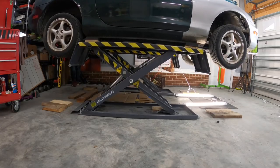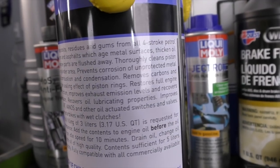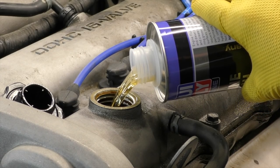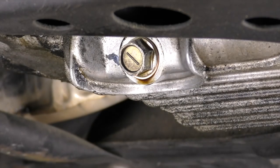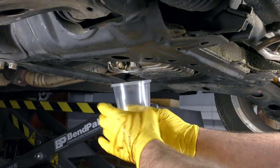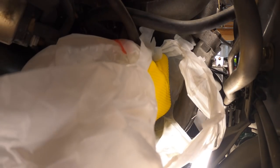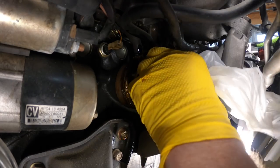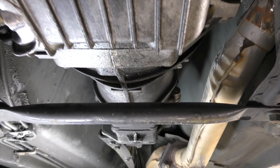Let's start with our oil change. This is a pretty straightforward oil change, but we're also going to do an engine oil flush — we'll add the flush treatment to the engine, let that run for about 10 minutes, shut the engine off, then drain the oil and complete the oil change. If you want to capture a sample of engine oil to evaluate, do that before adding the flush, since the flush may distort the sample. For filters in a tricky spot, I like to grab a plastic bag to help remove the filter — it'll capture a lot of the oil and make cleanup easier.